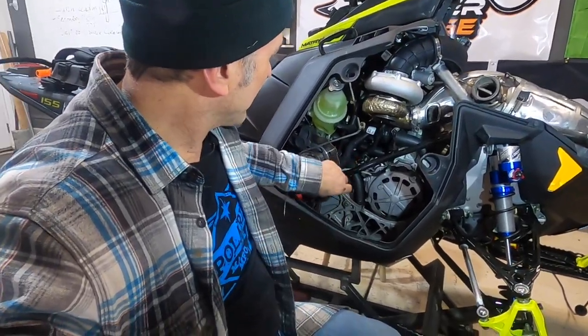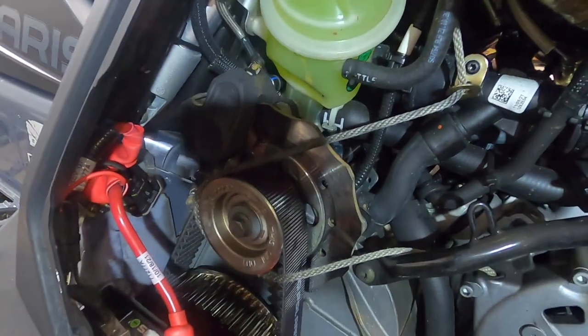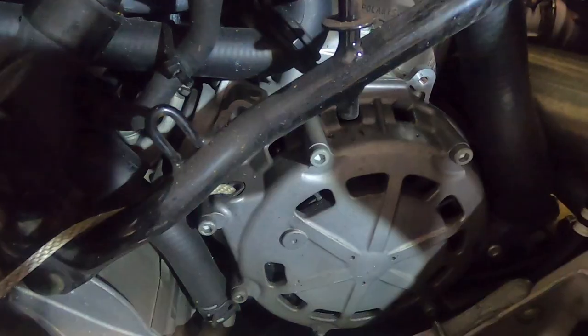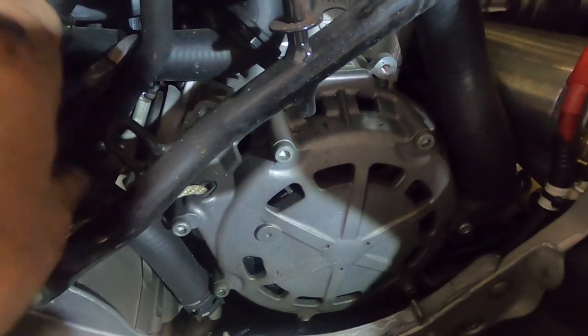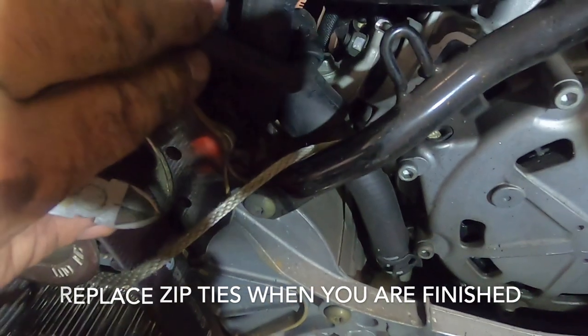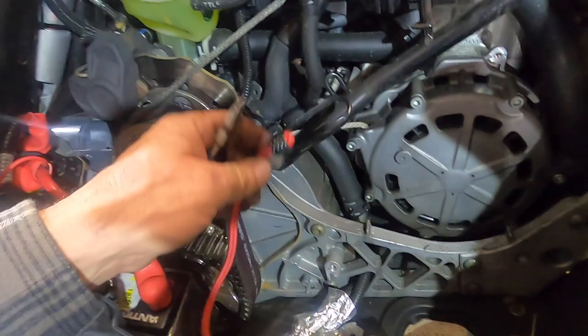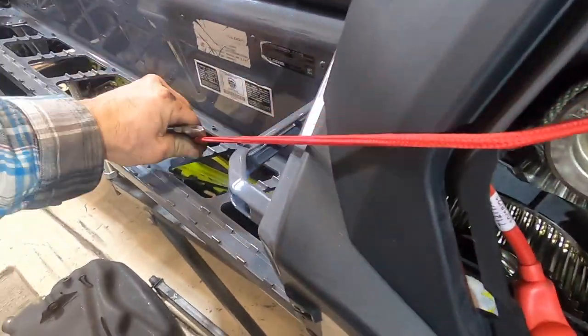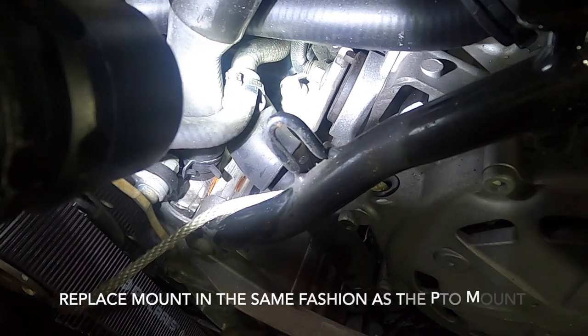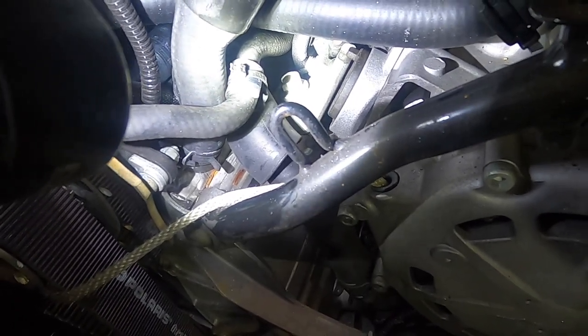Now we're over on the mag side. The motor mount is kind of buried down in there. One thing I've found: pull your pull rope out of the way, cut off a couple of zip ties, and this little hose on here — pull it back out of the way so you can get to the mount down in there real easy. I just use a bungee cord to hold everything back. Then we have pretty good access to our motor mount. We'll take the nut and bolt off and replace it with the other mount, then tighten it down just like we did on the other side.